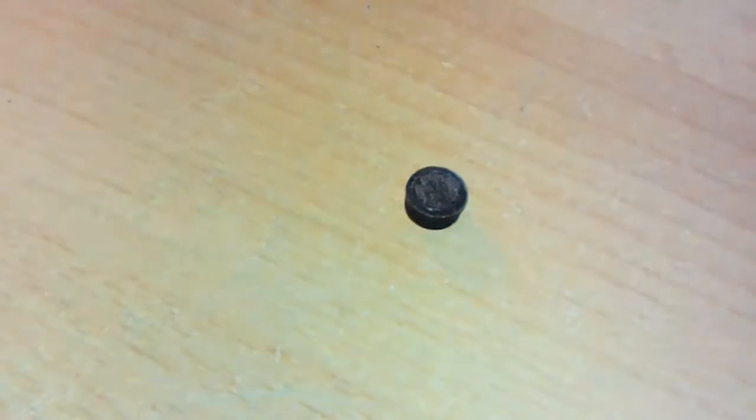What you need to do is get the Brightbox and flip it upside down. You've got four rubber feet. Very carefully — I use my thumbnail, or you could use a pry tool — pull these feet off. Pull them up carefully. You can see the screw underneath there. There are four of those. Put them on the desk sticky-side up so they don't lose their adhesiveness.